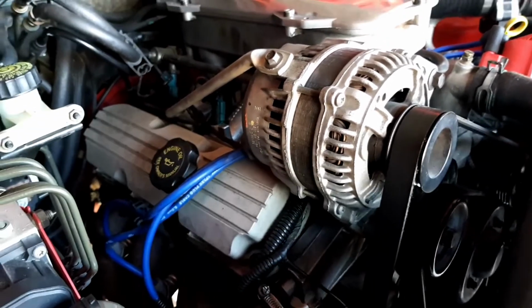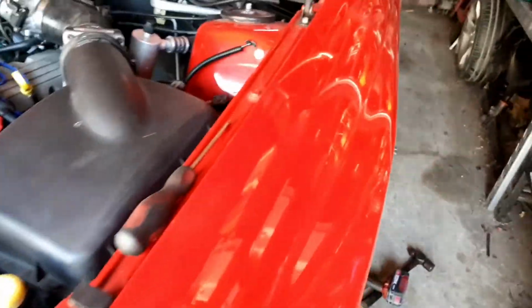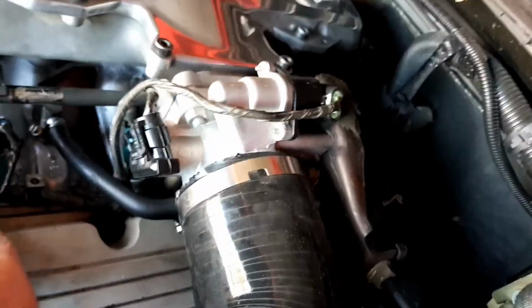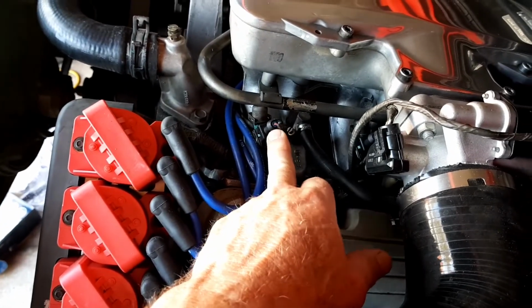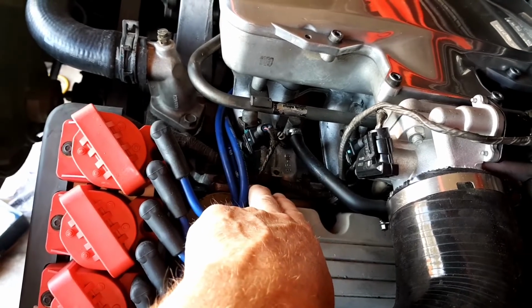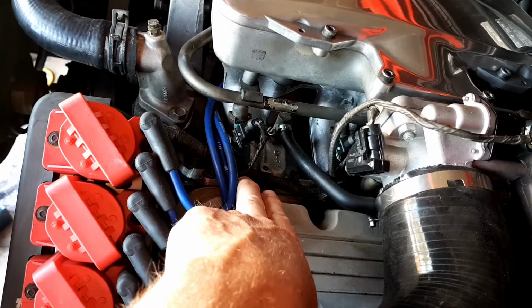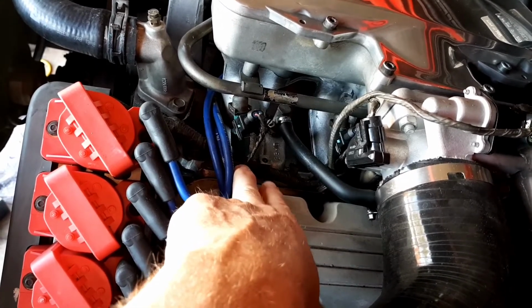And the other problem I had, if you watched the video, I was mucking around with the injectors, making sure they're all seated. Because you can't see both sides, I obviously didn't seat this one properly. So I pinched the O-ring down the bottom, going into the manifold. Had a piece missing on it.